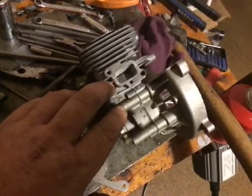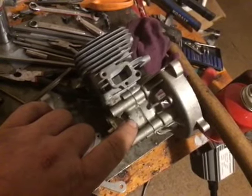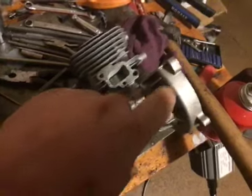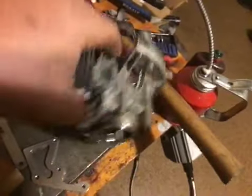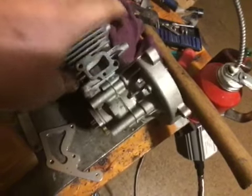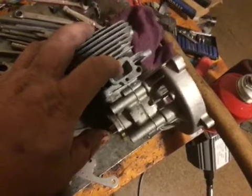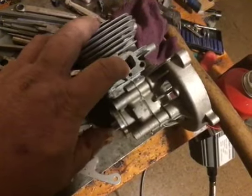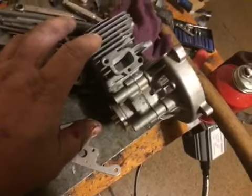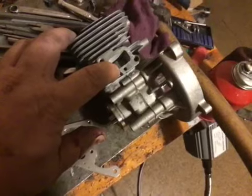Really going to be a badass piece. I made sure that crank was true but it really didn't need much to get it straightened out. New crank bearings, new seals. Got the piston lightened, boost ported the piston — not where you do for reed port but to charge the transfers on the sides. And lightened it of course.